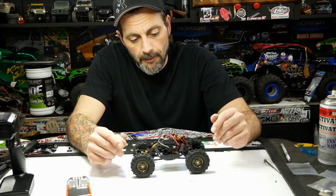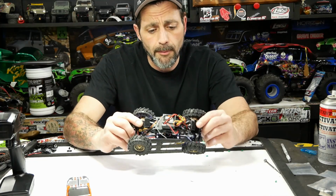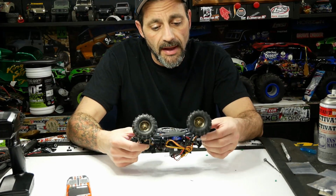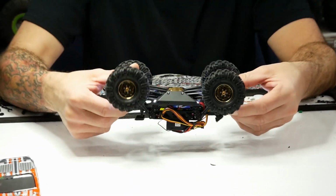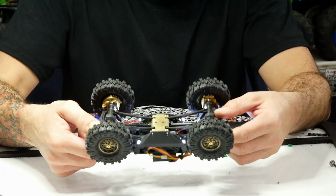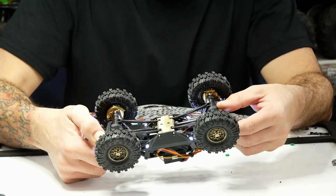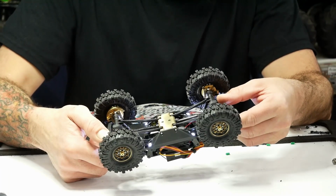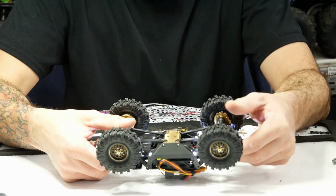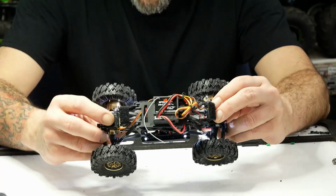So yeah, the 66 turn motor and motor plate fit in there nicely. Zero clearance issues anywhere. Everything fit good there. We got the brass skid plate on the bottom. Of course, the knuckle package on the front with the wider stubs. We were going to split up the weight package front and rear, but it won't fit the rear until we actually get the wider stub axles from another kit from Hot Racing to make the wheel stands a little wider.